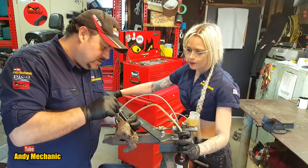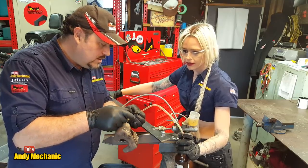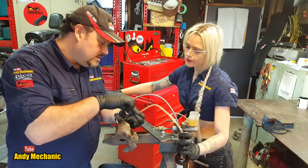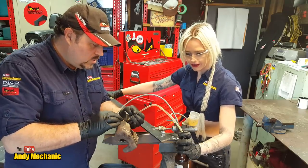Right. So one trick is for me to open it. So I'm going to open it now. And I'm just going to squeeze the pipe gently. I'm not going to fully lock it off. And then when it pressurizes, it'll force my fingers apart. It'll be like an auto bleeder. Yes, absolutely. So if you pull in now for us.